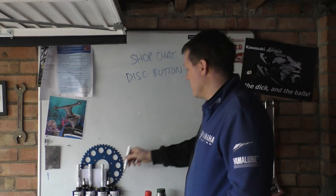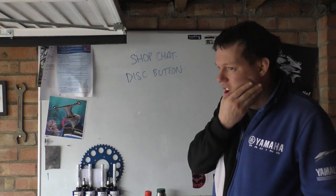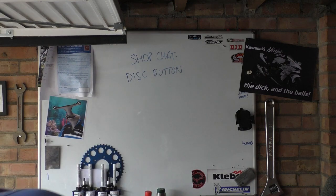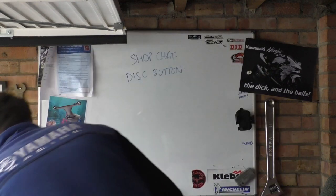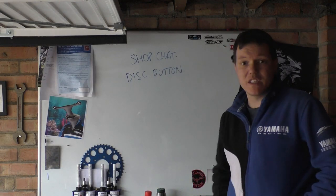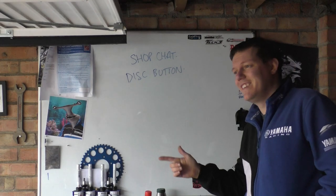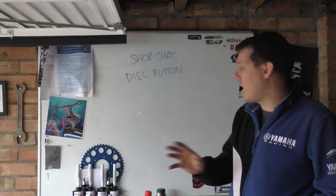For those of you who don't know what I'm talking about: high performance discs generally have buttons, whereas lower performance ones are just solid discs. If we look at the R5, it has a solid mounted disc — there's no buttons, hub carrier, or rotor. It's just a solid rotor fixed to the wheel, because it has a fully floating caliper. I did a video called 'Floaters' about what calipers are about, and we'll go more into that.